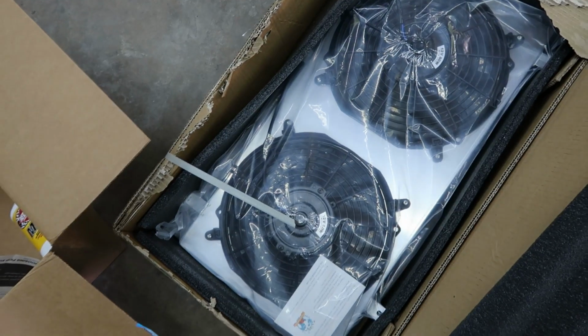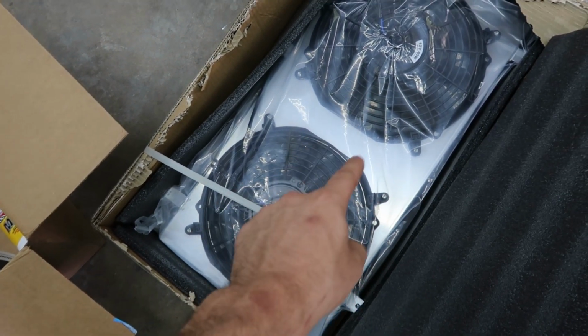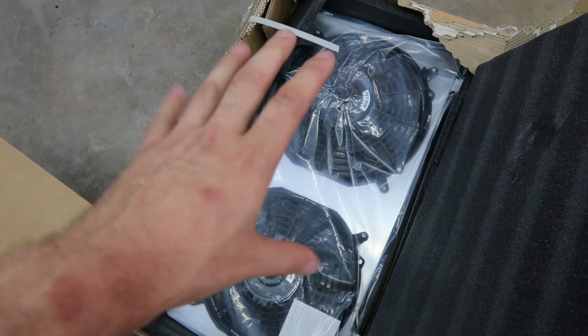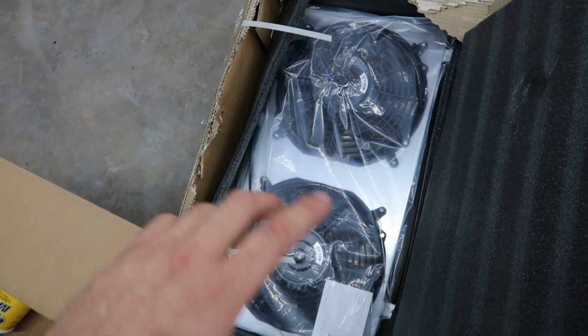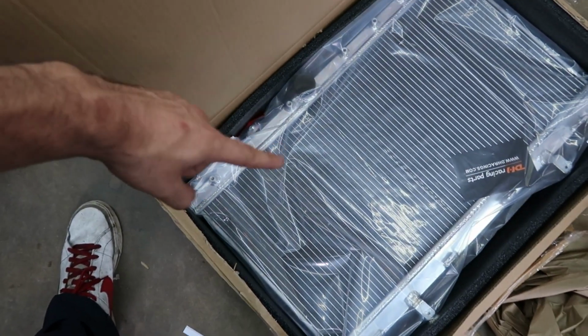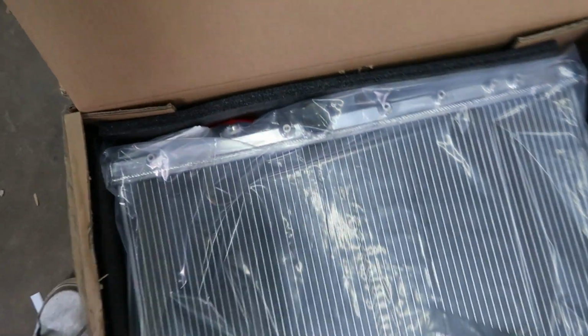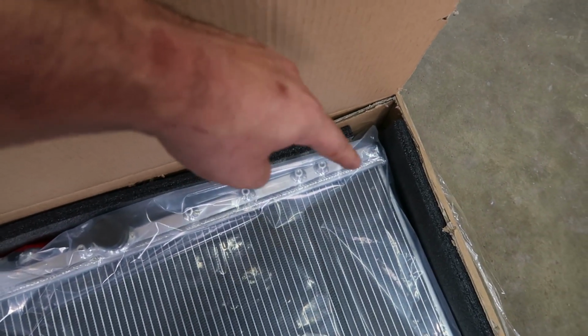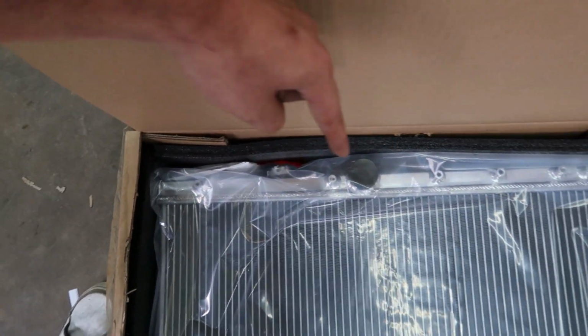And then something I was contemplating for a while and went ahead and just going with the easy, quick route is the radiator. And I went ahead and bought one that comes with a shroud with 2 slim fans. Depending on how good these work, I may put these small ones on because this is just eBay stuff. But this radiator is actually for a GD WRX, not a GC, because that way the upper filler neck is in the middle instead of completely on the corner, so that's less distance that I have to route.